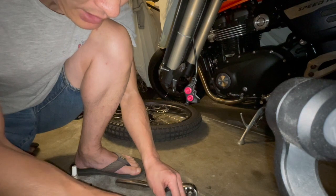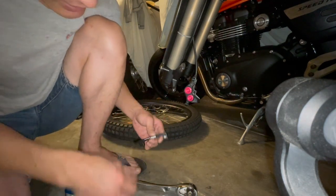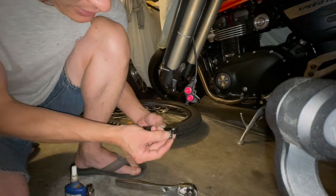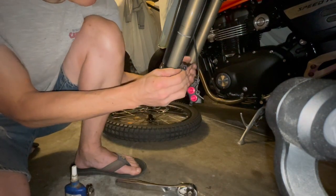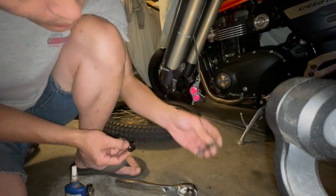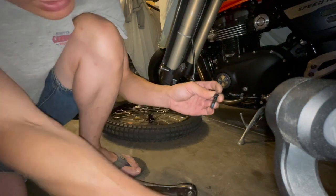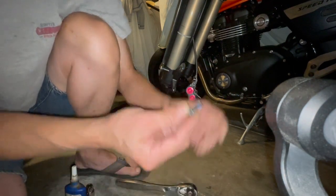I'm gonna have to find some bolts — I didn't realize this was a single bolt versus two bolts on the original. Found some bolts. You have to use proper bolts — for mountain bike brakes the thread insertion depth needs to be 10 to 12mm minimum; less than that isn't strong enough. Also has to be the right grade of bolt — these are brake-specific bicycle bolts so we're good. The adapter says 'up' so I'll orient it that way.